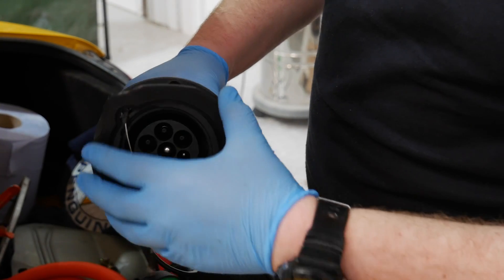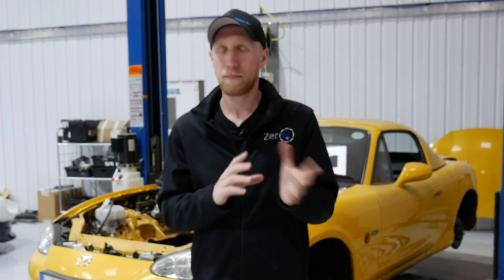On this episode I spend a day at Cage Laser and we get the front battery box built and TIG welded together. Josh gets the cradle built for the MX-5 which is going to hold the battery box, the motor and gearbox in place. He fits the Type 2 charge connector to make it look like a proper electric car. I'm going to do a tech talk on gear ratios, the math behind it, how you work out what your top speed of your vehicle is going to be, how you select your diff, your gearbox and your maximum motor RPM to suit your build. Plus we're going to have a quick look at the gearbox and what goes inside it, what we're fitting to this car.